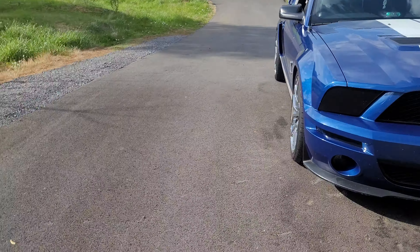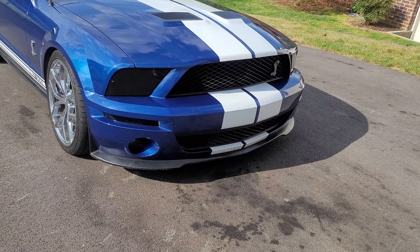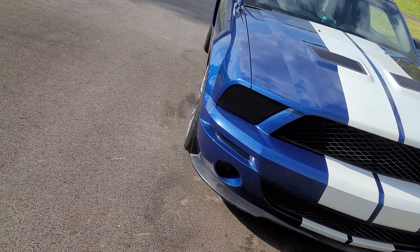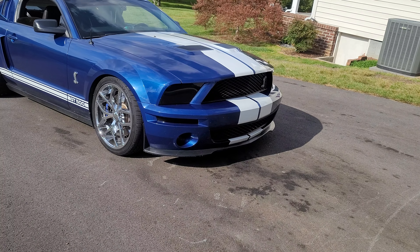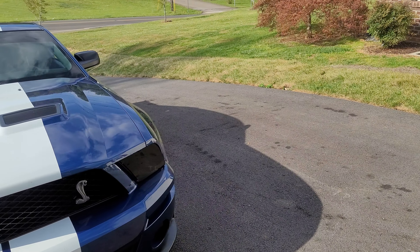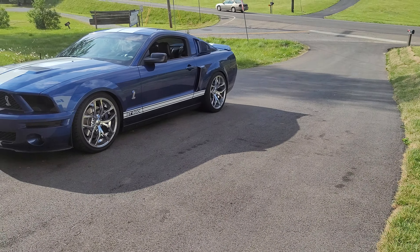The Trinity swap is really the cheapest way to add power to a 2007–2009 GT500. Now if I need an injector replaced I can go online or to any parts store and get a 2013–2014 GT500 fuel injector. It's all Ford parts — the Trinity is still a factory Ford supercharger from the 2013–2014 cars, so it's like a factory method of adding power. I highly recommend it, especially since you can find complete swap kits with elbows, fuel injectors, and boost pumps for a good price if you keep your eyes open.